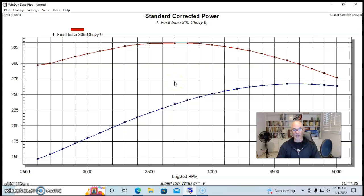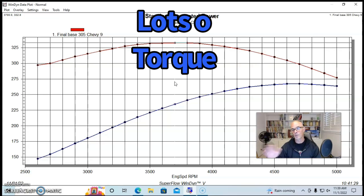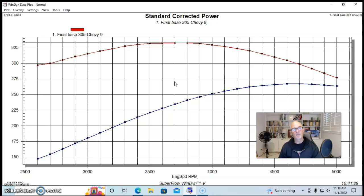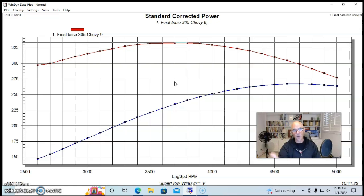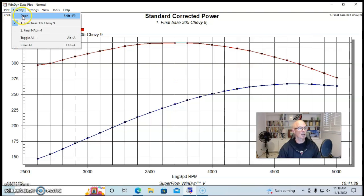You can see from the shape of the horsepower and torque curve that we haven't even reached the crossover point and the horsepower is already falling off. These engines were designed to make lots of low-speed torque. Whenever we talk about tune port motors, we always say Chevrolet should have put these in trucks — a truck with a tune port would have been an optimum combination. Lots and lots of torque, but here's what happened with our first upgrade.